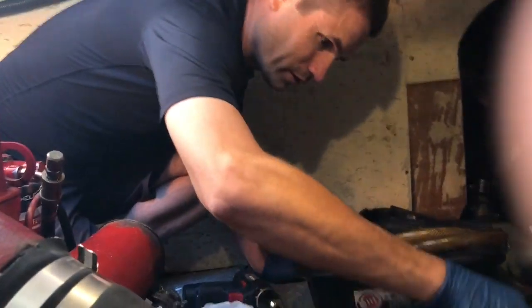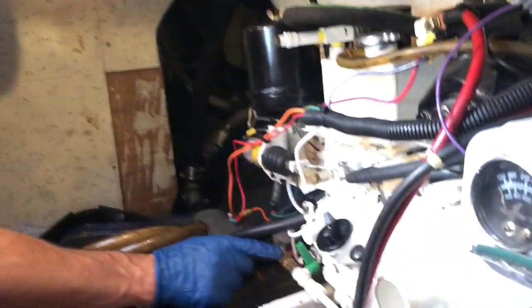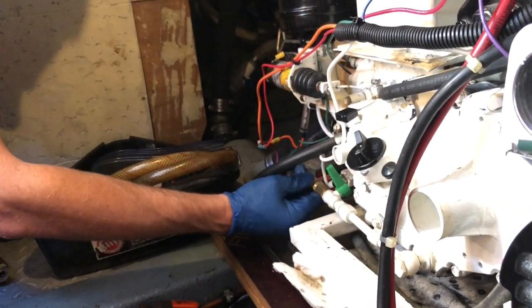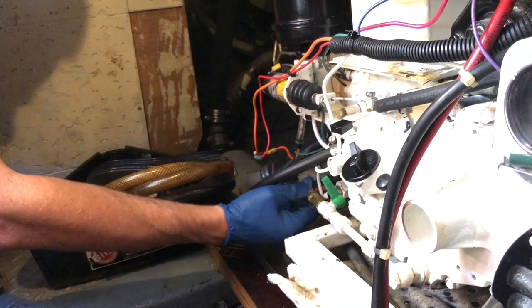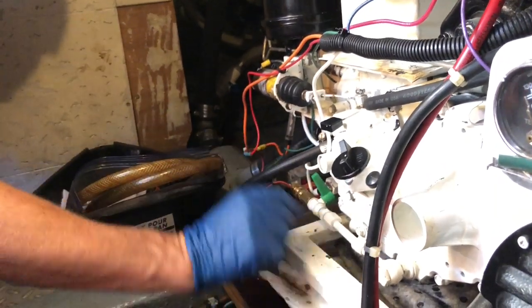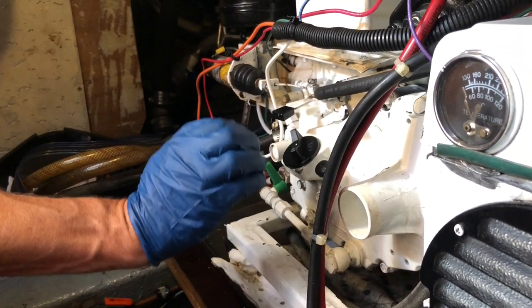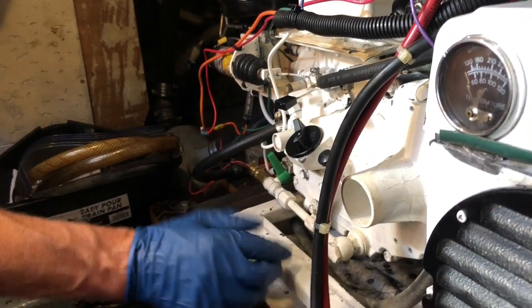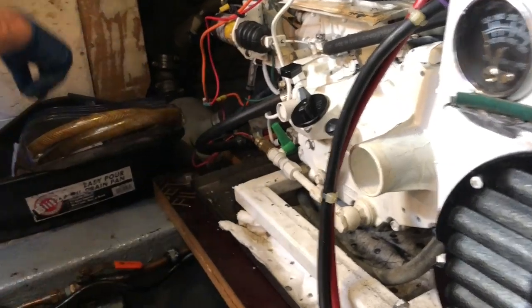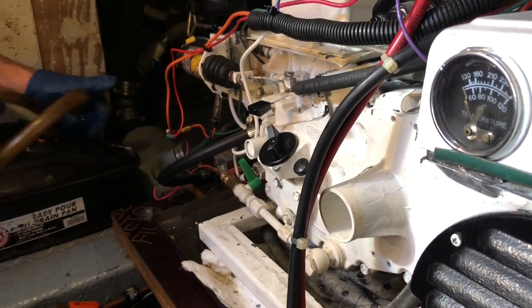This is our waste oil container. Here are my new adapters — I also put on a cap. Oil is warm. You can see I got a valve here. I had the mechanic, when I had this engine rebuilt, put this drain assembly on because where the oil plug was relative to the engine frame, all you could do is let all the oil spill into the pan and then mop it up — it was awful. Now that I got all the right pieces and adapters, it should make it a lot easier. I have this hose with a little pump.